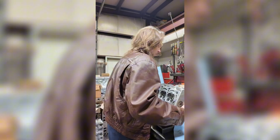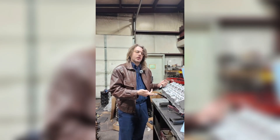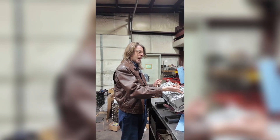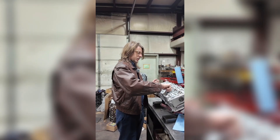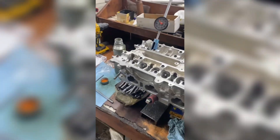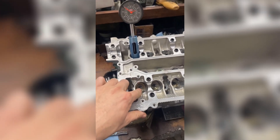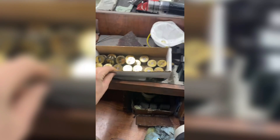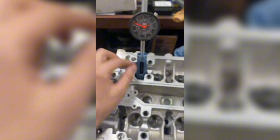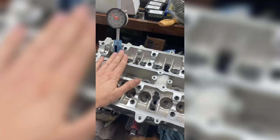With forced induction, everything is amplified. The intake has it too, but we're just going to clean those tight turn radiuses up, do a little blending on the sides, and this thing should be good to go back to Florida. I've got it all down to valves, which Zach disassembled and shipped to me. I'm going to measure the stem height so we can return it as close to factory spec when we put the new valves in, since that's what they were shimmed to.